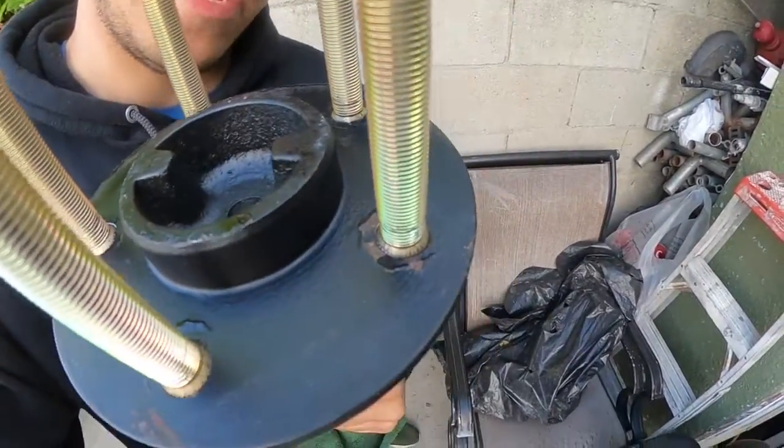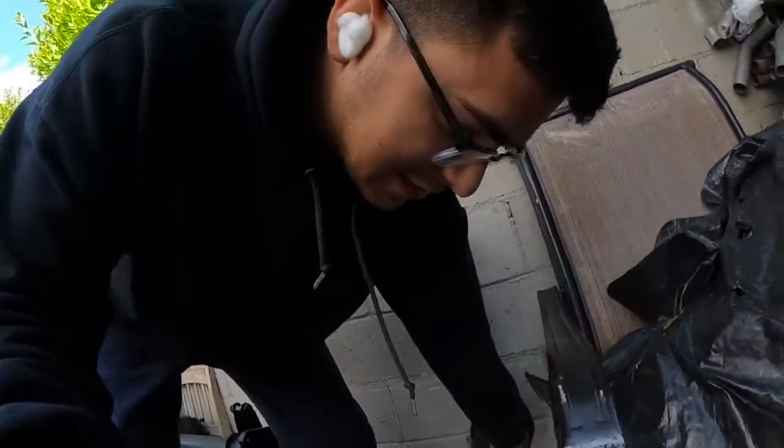I do have a complete axle that I would like to show you guys. Boom, kind of looks like a trident. Well, there's the gear, there are the ARP studs. If you guys hear me go back from APR to ARP, I apologize, but here they are. Also, if you notice, the paint is cracked off. The reason for it is because these ARP studs are a little bit thicker in diameter, so when you hit them in, you really hit them in, and this right here is how I got them in, and some elbow grease. That's probably why I'm out of breath.